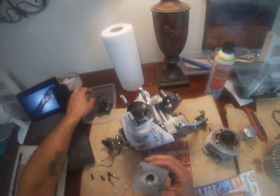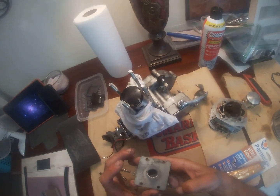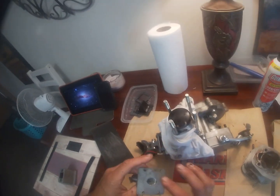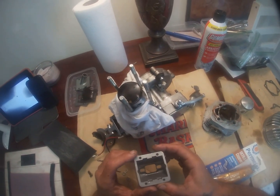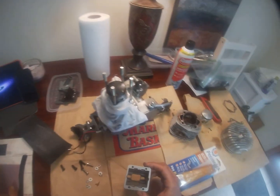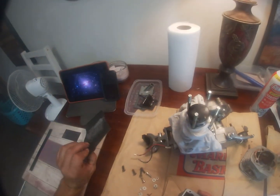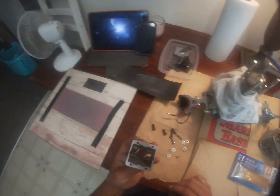And I had this running a couple of times before. You can see some of the wear that's left there from either the ethanol or just firing it. So we're going to take that with the 800 grit sandpaper, and we're going to clean that up. And I've also got the case here, the valve itself. I'm going to use, I believe this is 200, it might be 400 actually. We're gonna just go over this edge real quick, and we'll switch to this after, and then we'll try to start getting this airtight.